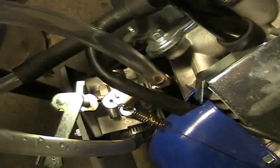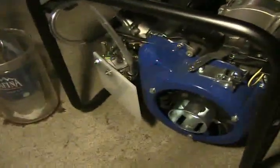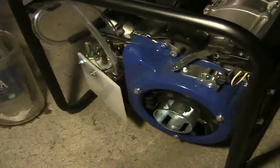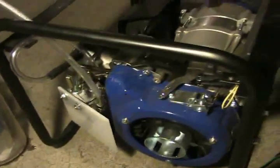The throttle position is still very much closed — this is barely cracked. What I did do is I drilled into the carburetor spacer right there, and I put an eighth-inch NPT thread to it to a quarter-inch barb fitting, and that goes up and around and into the crankcase ventilator. So all the air that it draws in literally comes through the crankcase. I'm doing that to pull back some of the HHO lost to blow-by, so this doesn't really have an intake per se — it goes through the crankcase ventilation system.